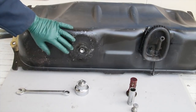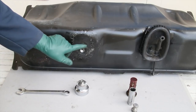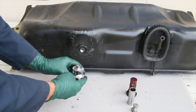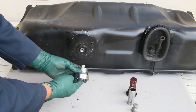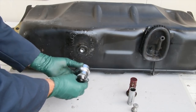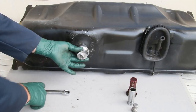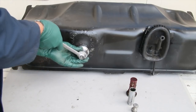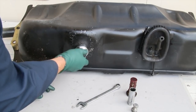On the other models — like the W107, 116, 123, 126 and so on — the tank screen is very large and requires a large socket. We've created a special socket by cutting and welding a 17mm bolt on the end, so you're able to get up underneath the car, above the axle, and get on that tank screen. That way you don't need any special ratchet wrenches — you can use a normal 17mm and break the tank screen loose on these other models.